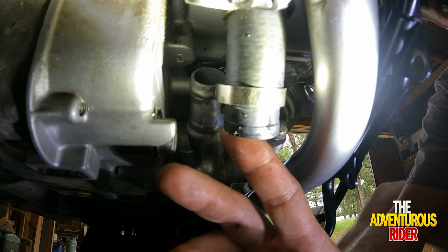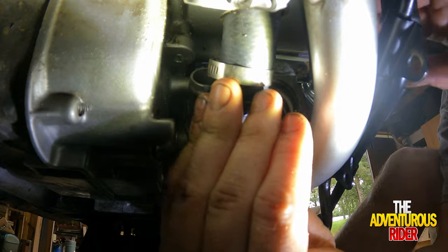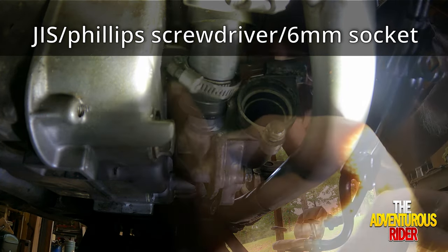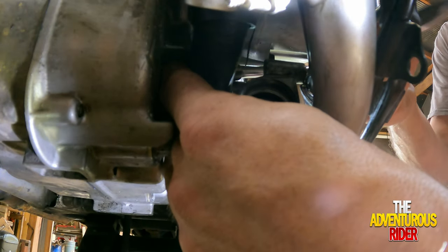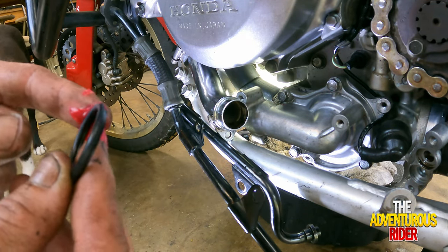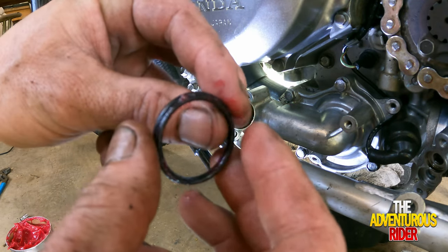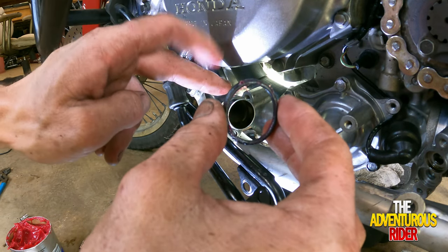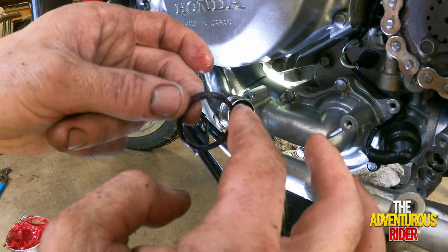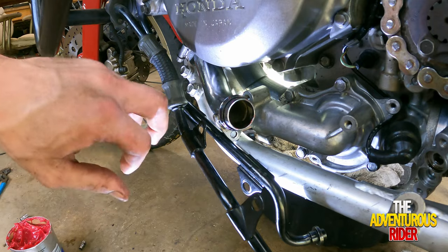Let's put our rear hose on — it's the one that is not metal. Once it's on all the way, tighten up the hose clamp. Now let's replace the O-ring right here — that's the part number for this O-ring — and make sure you put a little bit of grease on it. If you look at the O-ring it's beveled with a small side and a large side. I believe the correct way is large side to the outside with the small side facing in toward the water pump. That's what's going to seal against your water pump — once it's slid on, push it in to the water pump.